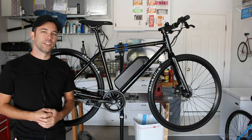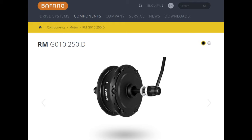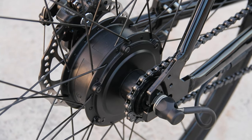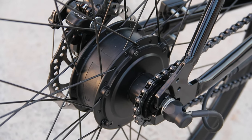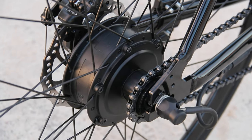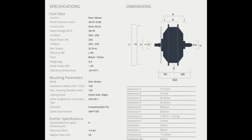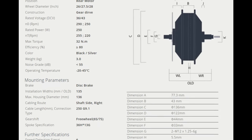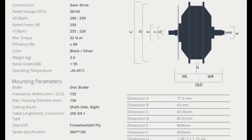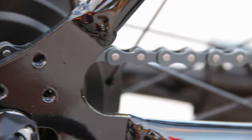Okay, let's finally get to the juicy part: the motor, the battery, and the controller. This bike has a Bafang RMG010.250.D motor — a 250 watt internally geared motor that's a very popular unit generally considered good quality. The gearing ratio is 1 to 4.42, which means it has more low-end grunt than non-geared motors, letting you get away with a smaller motor while still getting quite a bit of torque.